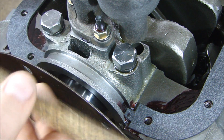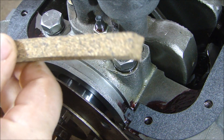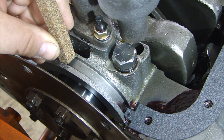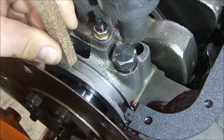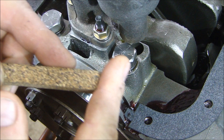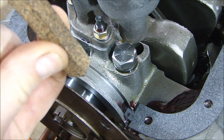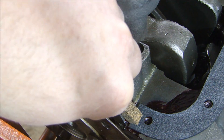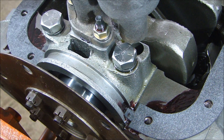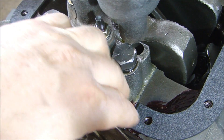It's time to put our oil pan on. The gaskets are already on the bottom for the oil pan rail, but I've got to put these cork gaskets on the front and the rear. The gasket is wider than the groove it has to go in at the rear main cap — it's designed that way so when you push it in and compress it, it fits. Also, the ends are cut on an angle so that when it goes around the curve of the cap, this end sits flat on the pan rail. I'm going to put a bead of right stuff in here, then put the gasket in place and slowly work it into the groove.